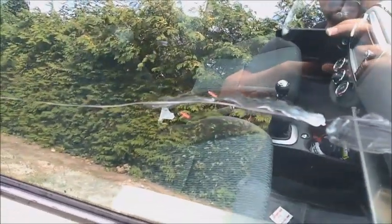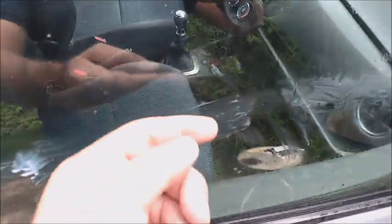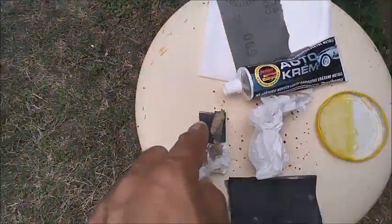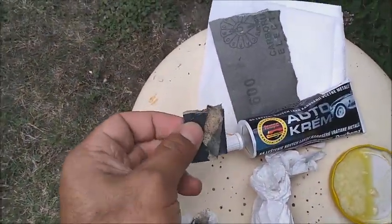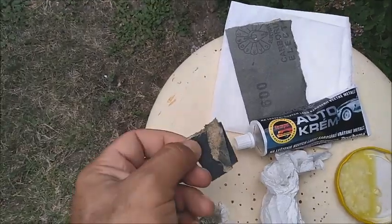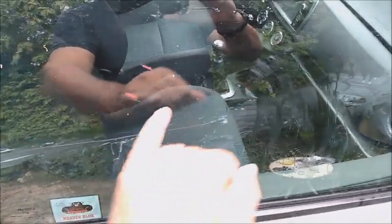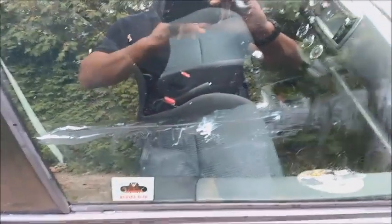This is the first cell in the 500 sanding size. And each time you move down the line, you can see it's fading already. Each time you move down the line, try to renew your paper. I'm still in 600. I'm using small pieces, so once one is finished, I use another one. I'll keep going this way, renewing my pieces and not increasing the area that I'm scratching already.